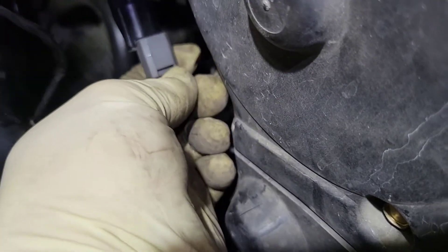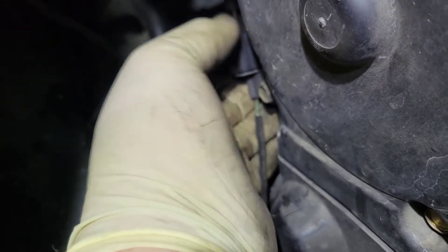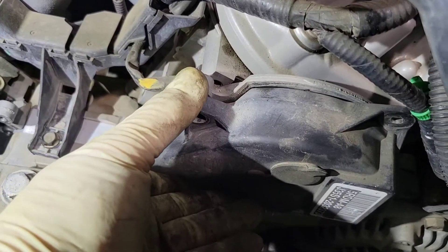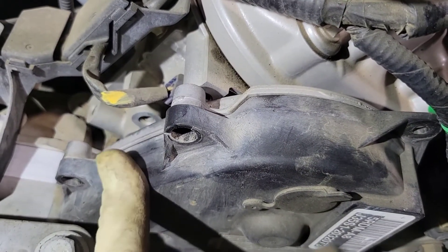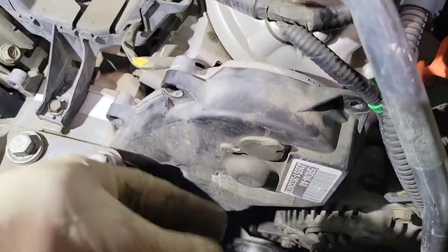For the connectors right here, on the harness side of the connector you push that button in and then you're able to slide the connector up or down or sideways — they go all different ways. So you've got to make sure you're looking at it and pulling it the correct way. Once you do that, you release it from its brackets and then you're able to get the harness moved and get the cover off. When you put the cover back on, it's got little channels and you've got to make sure you get them in the right spot so the cover pops back on correctly so you don't break it.